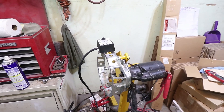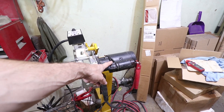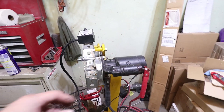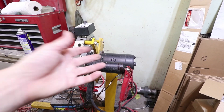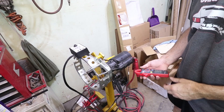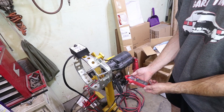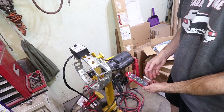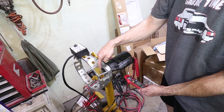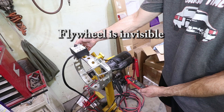For the purpose of setting up a little experiment, I'm using my test stand and the stock starter. This is the stock Bosch 911 starter. I'm going to be measuring the amount of current that goes into the solenoid before and after we add the relay to see if it's really worthwhile. Everything's connected right now. This measures the current through the wire that powers the solenoid. Right now it's measuring zero. So when I hit the start button, you're going to see the motor start spinning.